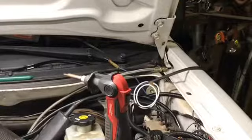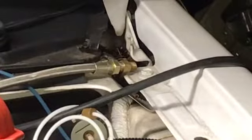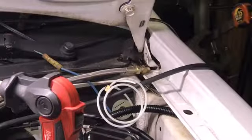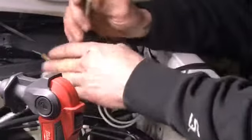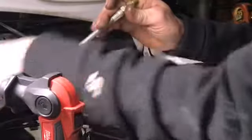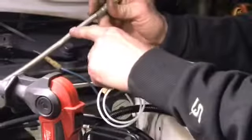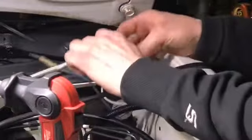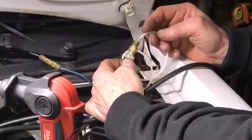All right, so I'm gonna put you back on the tripod. Right there, I'm gonna zoom your way in. There, I'm gonna come out a little bit. So here's our oil feed line from down there. I use the braided line because there's a lot of heat down there. This can withstand that heat. This will melt instantly.